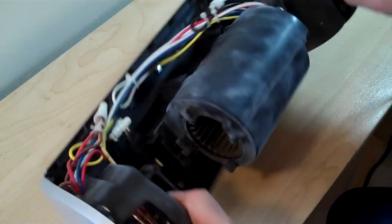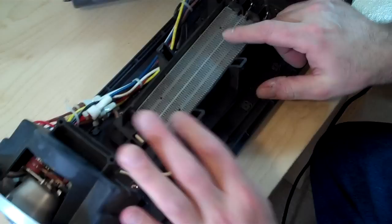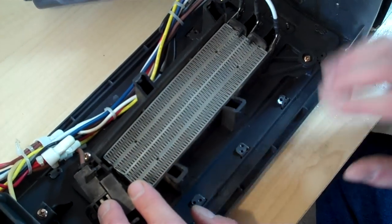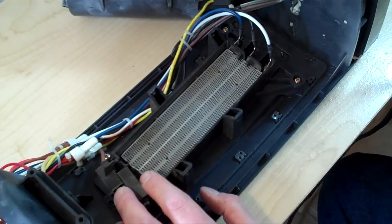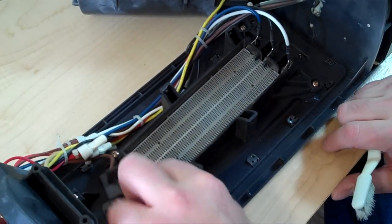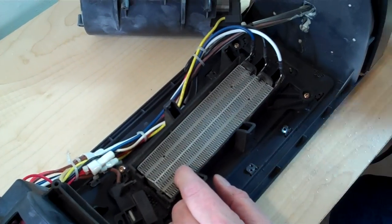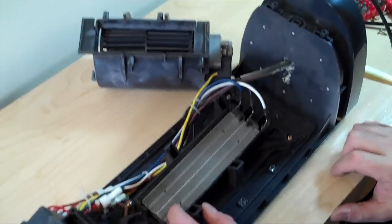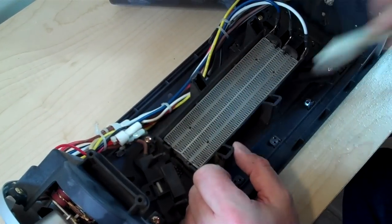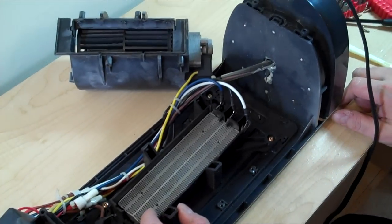Once the screws come off, flip it back up and there's your element. The front side doesn't get dirty — the inside gets dirty where the blower is, the side facing the blower. I've already cleaned this one; all I did was clean it with a toothbrush. You can actually take this element out, pop it out and slide it back in. If you've got a can of high-pressure air you can use that to clean it out as well, but you might want to take the dirt off first with the toothbrush. Putting it back together is just the reverse — it might be a five-minute job.